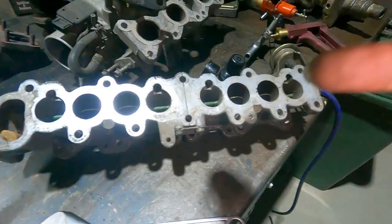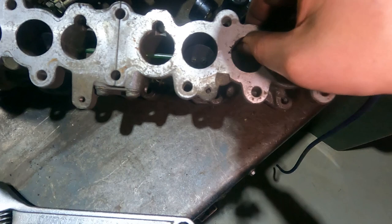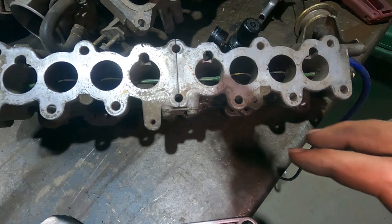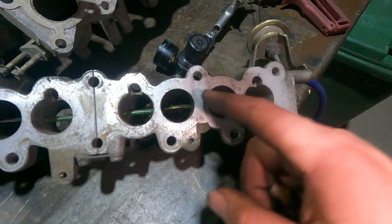If you are curious about that removal process, what you need to do is push the shaft out the end, undo the screws on each of the butterflies to remove it from the engine, then you need to go in with your TIG welder and weld up where the rod goes so the air is not escaping out the side of the intake manifold.